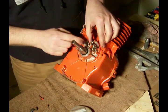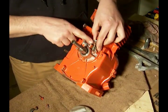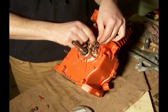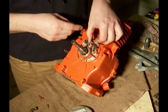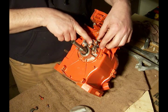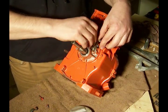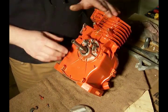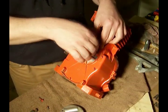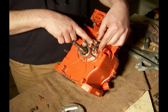Now the point system here, as we learned in a previous video, there's a plunger in here. And what can happen if you change this over and take all of this out is oil could come out through that hole. So if you're going to keep this in there, go ahead, cover this up and put it away. Or take this all off, pull that out of the hole and plug that up with something.